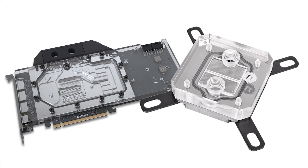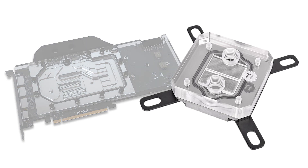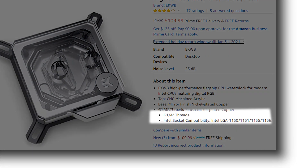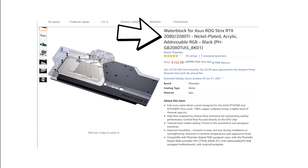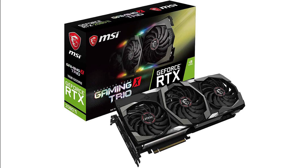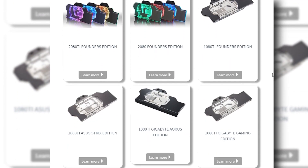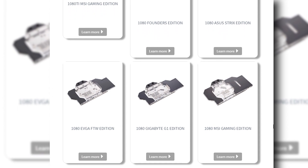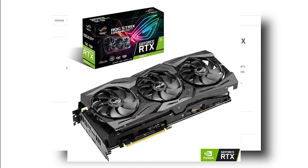Next up are water blocks. These water blocks sit on top of your CPU and GPU and allow incoming water to transfer heat to the radiators and cool down the water in your loop. For CPU, make sure your water block is for the CPU chip you have, which should also be the same chip your motherboard supports. For your GPU, make sure it matches the same card number as well as the same card brand — for example, different companies like Asus, Zotac, MSI will put their own twist on cards like the 2080 Ti. So your GPU water block has to be for the exact same GPU you plan on getting. In my system, the 2080 Ti water block I got was specifically for the Asus 2080 Ti.